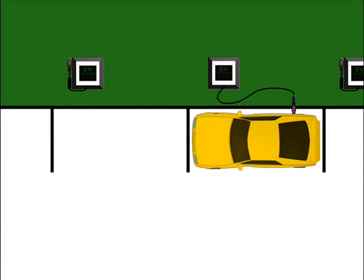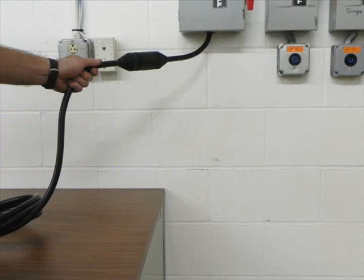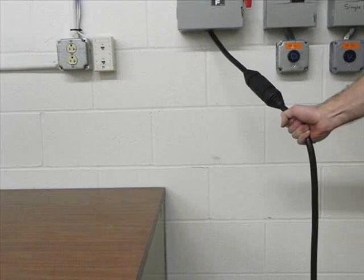In the case of a roll-away, putting strain on the charging cable is as easy as not being parked during charging. Adding an inline breakaway will follow the strain at any angle, properly break the connection, and safely shut down the system.